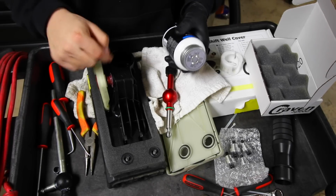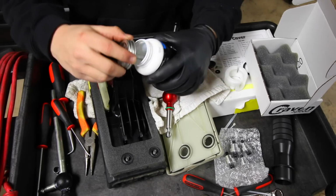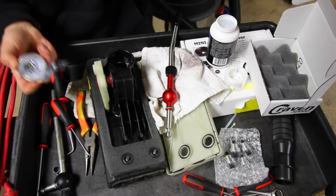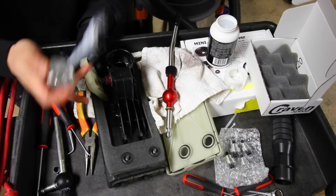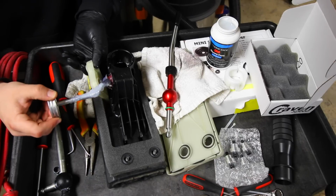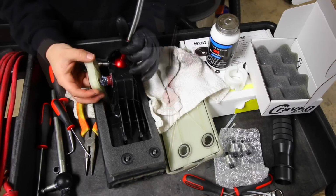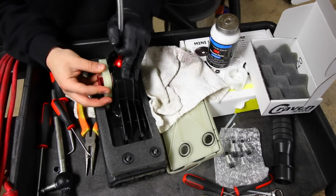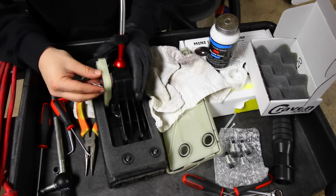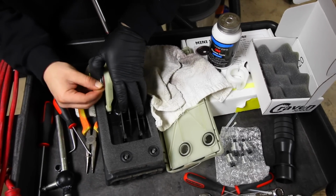Now, I forgot to mention that when you're putting all this stuff back together, wherever you saw a component that was lubricated, it's very important to re-lubricate everything once we put it back together. That way everything's gonna work properly, nothing's gonna be wearing out prematurely. So what I have right here is some 3M silicone paste. I'll have a link for some in the description box. And you're just gonna coat anything that was lubricated from before. Now if there's any excess, we can wipe it off. You just wanna make sure that everything shifts and operates as it should. Nothing should feel sticky, nothing should really grab. Everything should work just like how it was designed. So right here, I'm just pushing that clip back over top to lock all this in place.